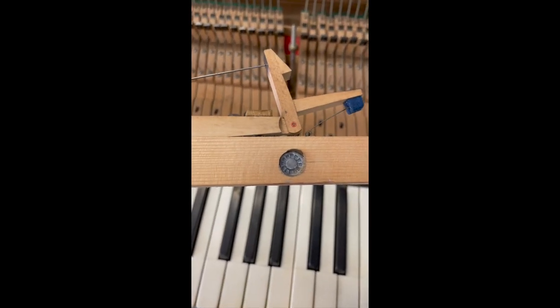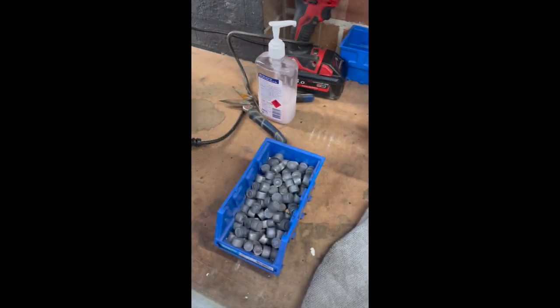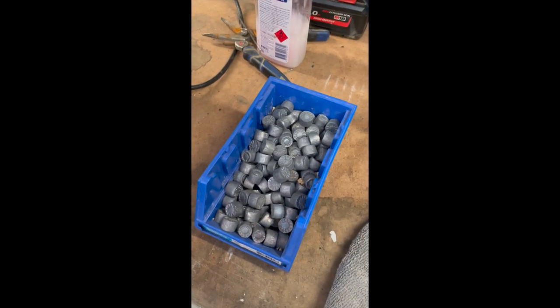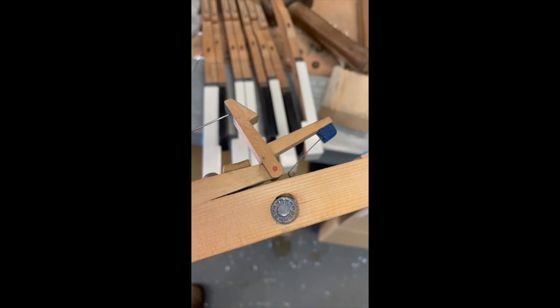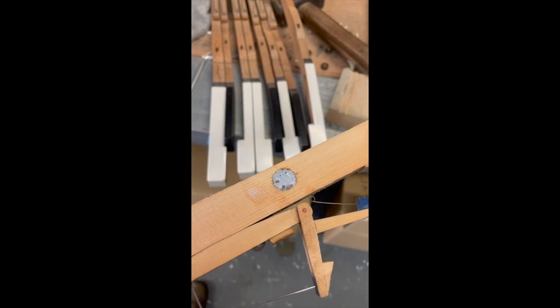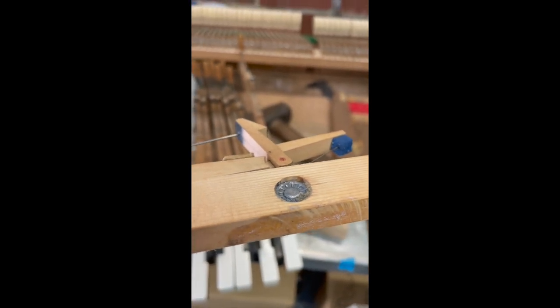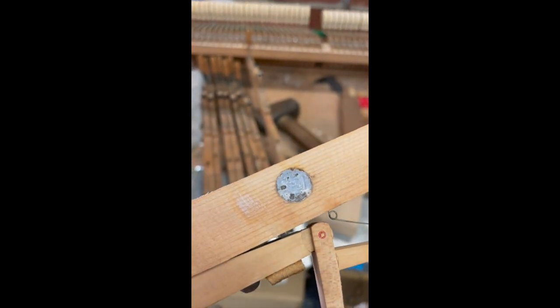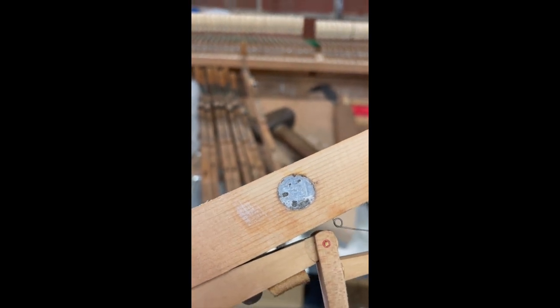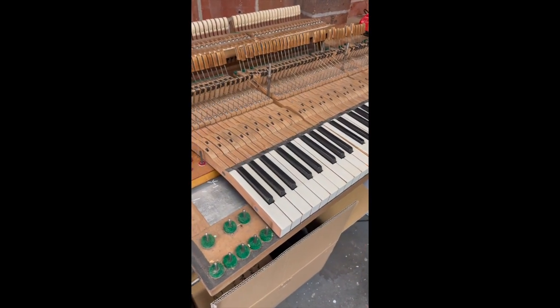Success — we've installed a new lead. The way that we did that was literally just drill it out on the drill press and then install one of these. I've got plenty of these — they're actually Yamaha leads, but lead is lead. What we do on top of that is just put a little layer of super glue on top once it's been installed, to basically work as a layer between the lead and potential surface moisture, and just to prevent any expansion in the future. So we'll install it back and do the reinstallation of the stack.